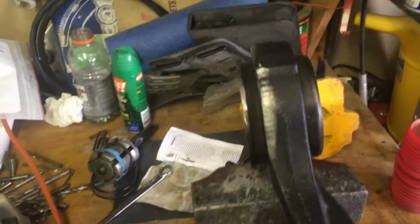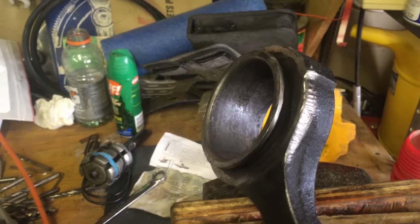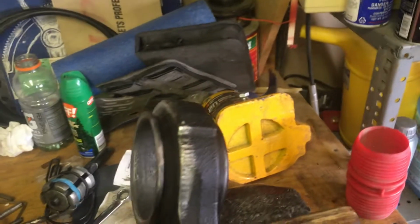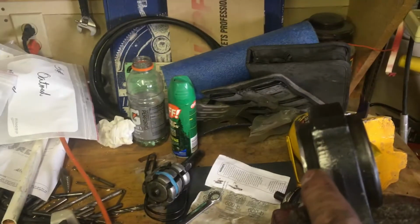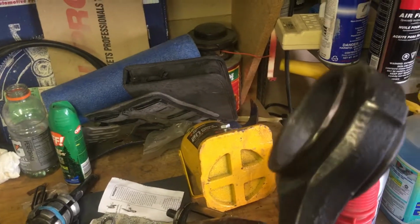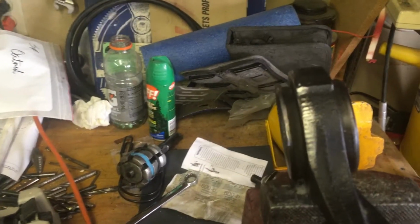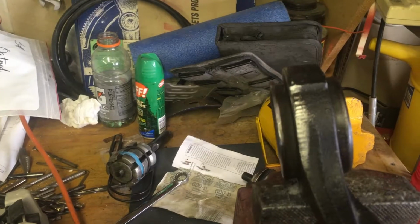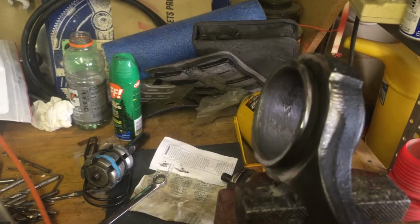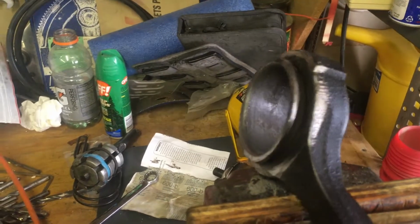We had to make a little adjustment here. This flange, this bushing piece from the original, right here, has this lip on it, and I don't know if you can see that real well. Anyhow, that lip was quite a bit bigger, and it was causing the bushing to pop back off. The bushing was acting like a rubber band, squeezing out, and then it would slip back off. So I had to grind that down a little bit, and I'm going to have to start over with sliding things together. So I'm going to do it again.